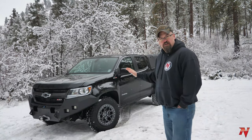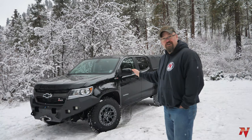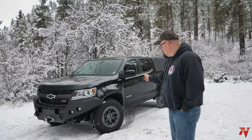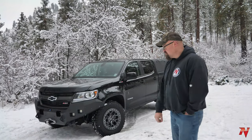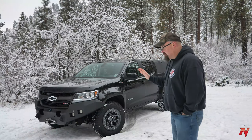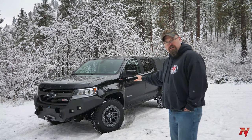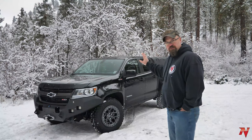Drivability-wise it felt awesome. The 4.10 is the ideal ratio in this diesel pickup on a factory tire. We've got the new AEV Crestone wheels and roughly a 32-inch tire — this is a 235/80R17, about nine inches wide and almost 32 inches tall. This would be about the limit of what I would do on a 4.10 gear. If you're going to build anything on a gas or diesel truck in a Chevy Colorado platform, up to about a 32-inch tire, I would recommend a 4.10 ratio. If you're going anything bigger than this, skip straight to a 4.56.